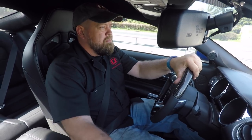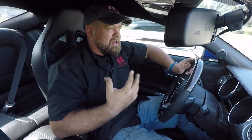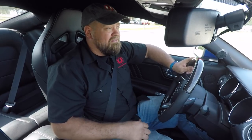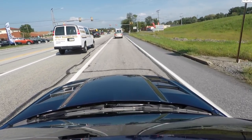The first thing you'll notice with the new clutch is the engagement point will probably be a little different than you're used to — it might be a little higher or lower. You might get a little bit of chatter, but with the SPEC clutch, not at all. I can definitely feel the engagement — it's more aggressive than I was used to. It engages a little sharper, but my old clutch was slipping, so I was probably just used to that soft feel. No chatter at all; it gauges nicely at the top with a real solid feel. On your test drive, don't beat on it — about 500 miles is a good break-in for a clutch. This ferro carbon disc will break in a little faster than a normal Kevlar clutch, but still put a couple hundred miles on before you try going wide open throttle, because it will slip. If you get it to slip too badly, you can actually glaze the clutch, making it really hard to break in properly.